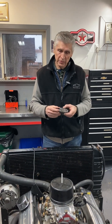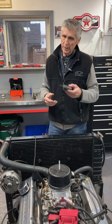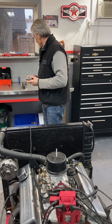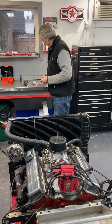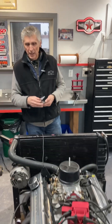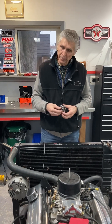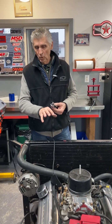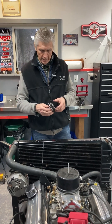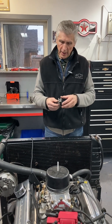I can't be sure whether the pump plunger failed first or whether the camshaft started to fail first and sent shrapnel into the bore. Even with cause and effect analysis, I don't have a clear answer. But my thinking right now is the stuck plunger is the most likely cause. We've already changed the pump. This is a roller cam now, so the startup cam break-in issue is not a concern — we had a nice clean start.